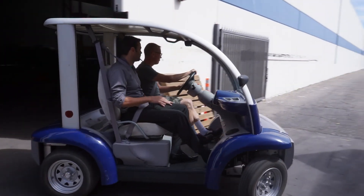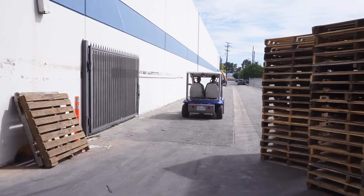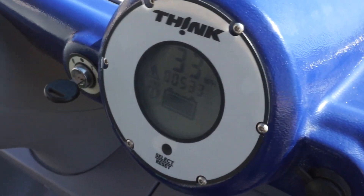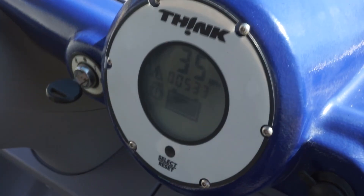If you are using your onboard charger, verify the charging voltage is between 84 and 88 volts. If you have a programmable charger, also set the charging voltage within this range. Never charge your Falcon batteries above 88 volts to avoid damage. Dave just got the batteries in — his first drive in 13 years. He says the cart feels quick, light, and responsive, and he got it up to 35 miles an hour.